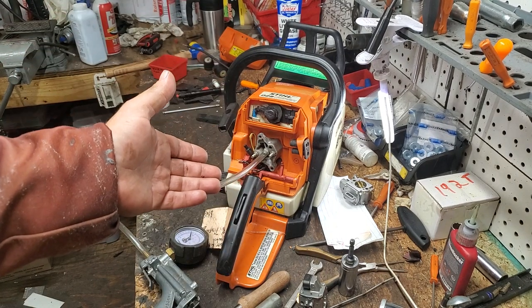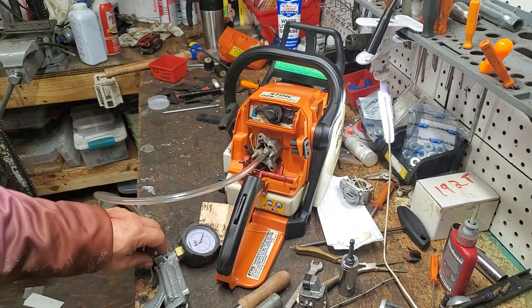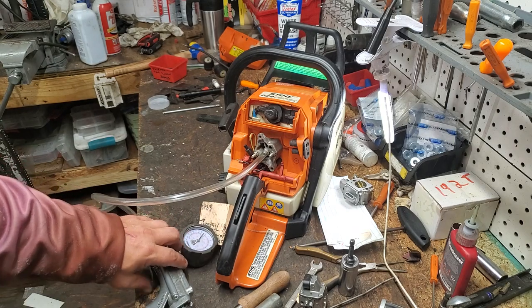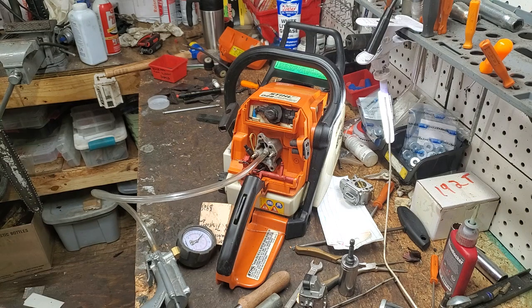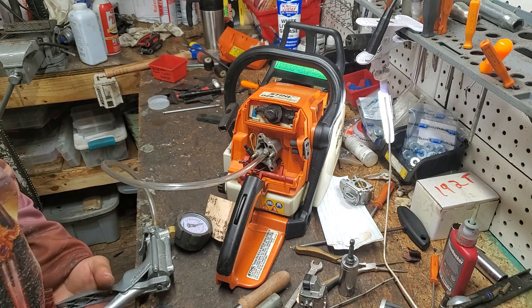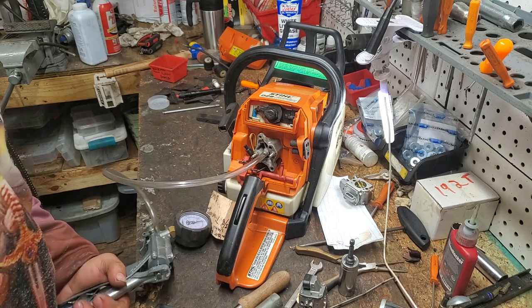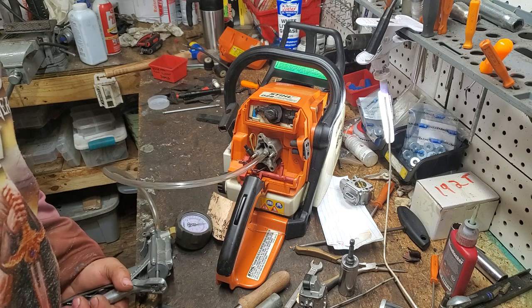Okay, I hope you guys got everything you need because I have something to tell you. On vacuum, we have a very slow leak down. So we'll release our air, turn it to pressure, go up to 7.5 pounds, and we'll go get the soapy water out of the other building. While you guys try and go down in the comments and guess,